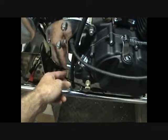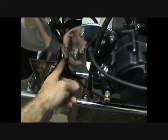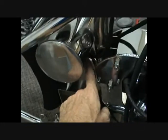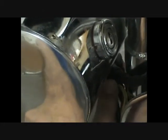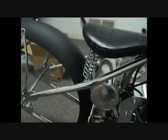You do have a little bit of wiring to deal with and some of it is a little too long. You have your main wiring coming from the bike and you'll need to route it up underneath the motorcycle, doing your best to hide it. What we did was open up the fake oil bag where all the electrical parts are and ran most of the wires up into the oil bag underneath — just make sure they're not rubbing on the edge.